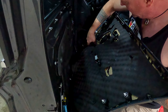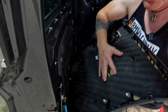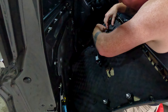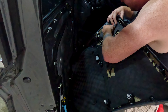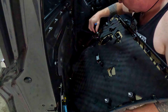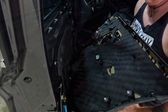Press the little clip and pull the plug off. Do the same on the other side. Keep in mind I've got the wavy foam in here from the first install, so if yours looks a little different, that's why. Just come in through here, carefully unplug everything — especially the fiber optics, that plug tends to be a little touchy. Get all your plugs undone and carefully set your door card aside.